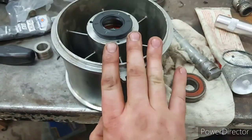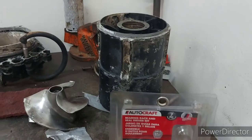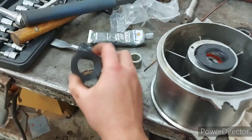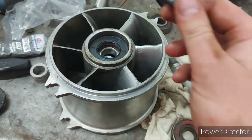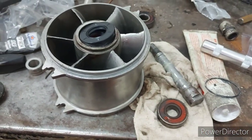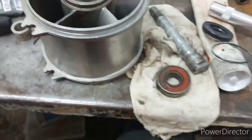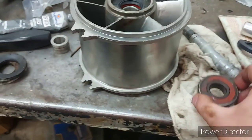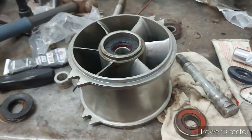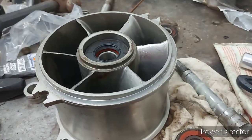If you've never done one of these Polaris pumps before, I thought the seal went on this side but it was way too small. I took it apart further and what they do is put two oil seals on this side over here. I looked at the exploded diagram and that's how it's supposed to be. You use your bearing to help push the seal in and it'll seat perfectly — just tap it until you feel the difference.